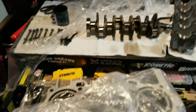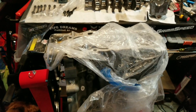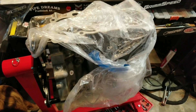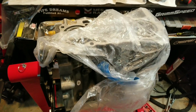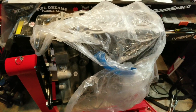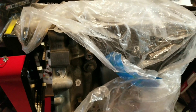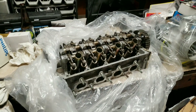It turns out this is not the JDM D15B VTEC engine I thought it was, even though it has the D15B stamp. I found out that a lot of these engines, especially in Japan, were stamped D15B, but there's a variety of engines they stamped that way. This is actually the D15Z1 fuel-efficient VTEC engine. What they did was take a D15B block, put the crank from the D15Z1 in it, and also attach the D15Z1 head.